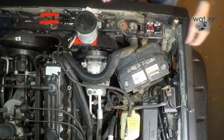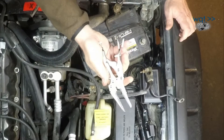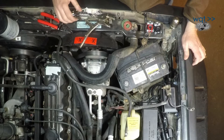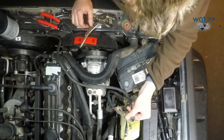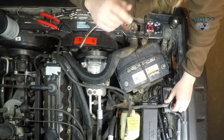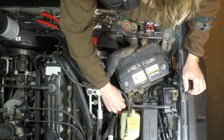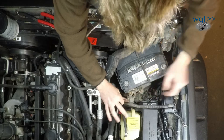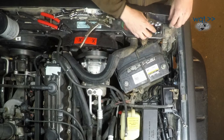I've already pulled these terminals — I actually had to use vice grips because the condition of the bolts had gotten so bad. The reason I'm changing out these terminals is they are 200,000 miles old and have been heavily abused. The negative isn't too bad except the bolt is failing, and the positive has had some insulation damage and is starting to corrode back, so I'm going to cut that damaged section off and re-terminate.